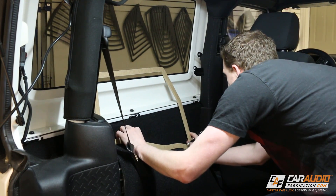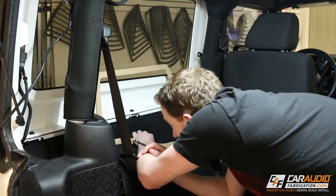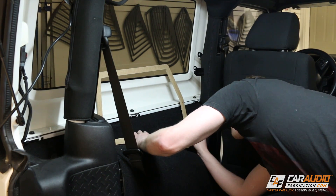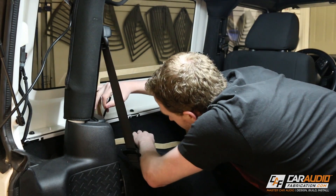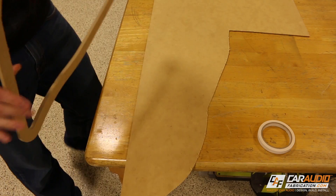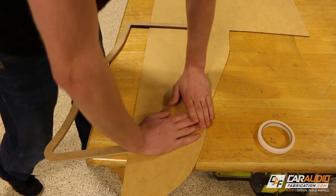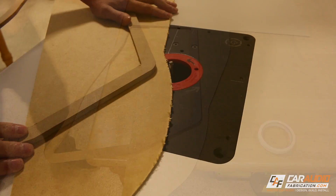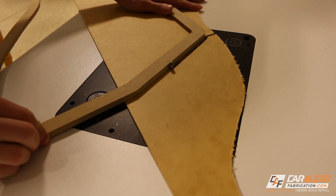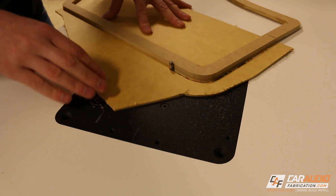If you've seen my previous video, you'll know that I was able to make this shape for the outside of the box. Because I need part of the box to extend closer to the window, I'm marking lines on my outside shape to transfer them to a piece of wood. I line the bottom of that shape up with a straight edge on a scrap piece of wood and template tape it into position. Over at the router table I'm using my go-to router bit, the quarter-inch spiral flush trim bit, to cut through the material and give ourselves our shape.